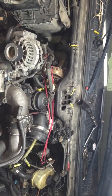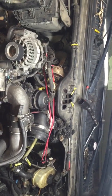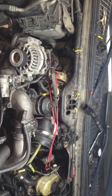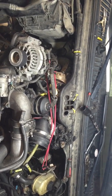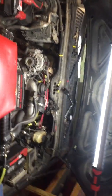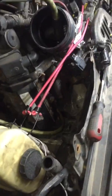If an IPR valve is stuck at 14 at 160 RPM, generally you're going to see about 200 pounds. Well this is building 400, which is concerning because if it's building 400 cold, it is so freaking close. I went ahead and yanked it — there was physically no screen on the IPR valve and there's no screen in the bore. What the hell.